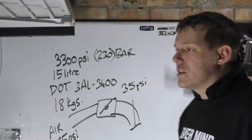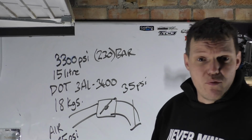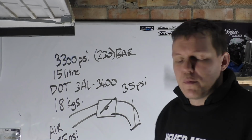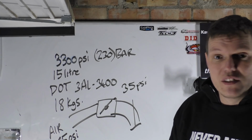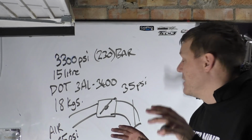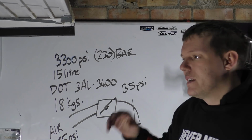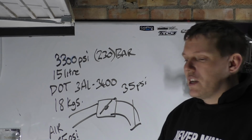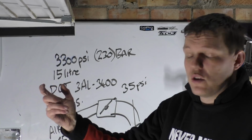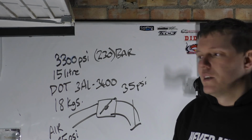to feed the engine. Now, the real benefit from this is, yes, you can go high PSI and stuff like that, but one of the other benefits is that they can massively drop intake temperatures, so basically increase density an awful lot as well. And that's why they can get silly numbers out of it. It's just like spraying a deodorant can, you feel that it gets cold.